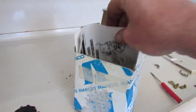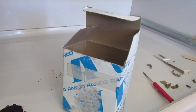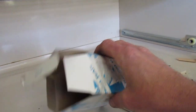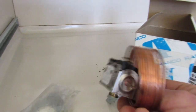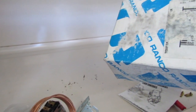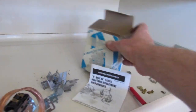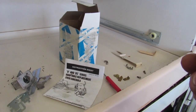I had to go shopping. Here's another one — apparently the cold control we bought Wednesday had the wrong control put in the right box. Here's our new one: it has an 84-inch capillary. That's about 20 inches too long, but we can work with too long — we can't work with too short. Next step, we've got to start fishing this thing up through the cabinet.